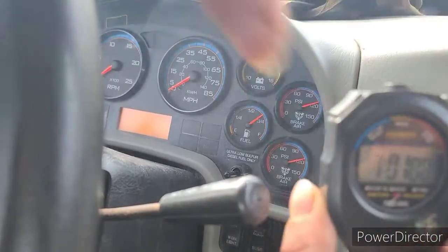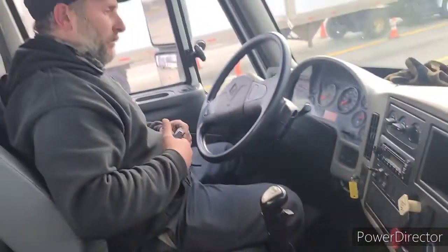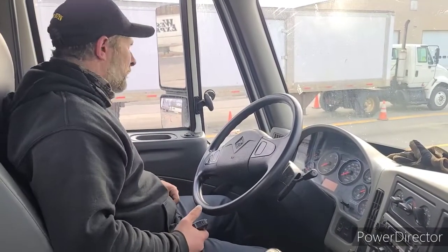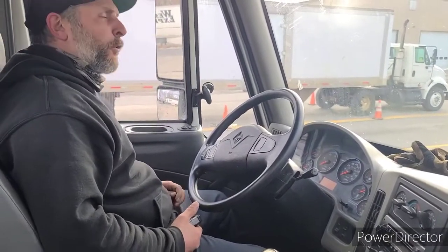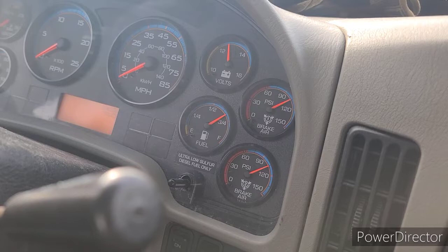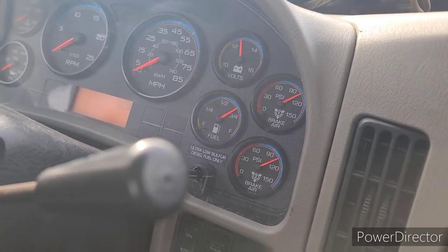My minute is over. I did not lose more than 3 PSI in one timed minute. And my next test is my 4 PSI air loss. I will apply approximately 90 pounds of pressure to my service pedal, and after my initial loss of 5 to 15 PSI, I can lose no more than 4 PSI in one timed minute. My initial air loss was 5 PSI. Timing now.